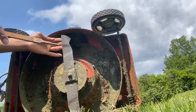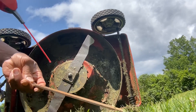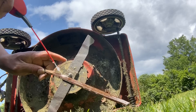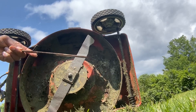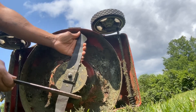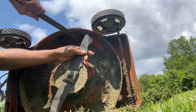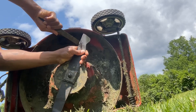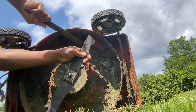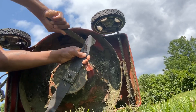Now what I'm going to be doing is sharpening the blade so that the lawnmower still cuts good. I'm going to put a little oil on this file. This is the blade, and the sharpened edge is only on one side — it's on this side, not the back, and it's on the opposite side on the other end of the blade. So we're going to sharpen this.